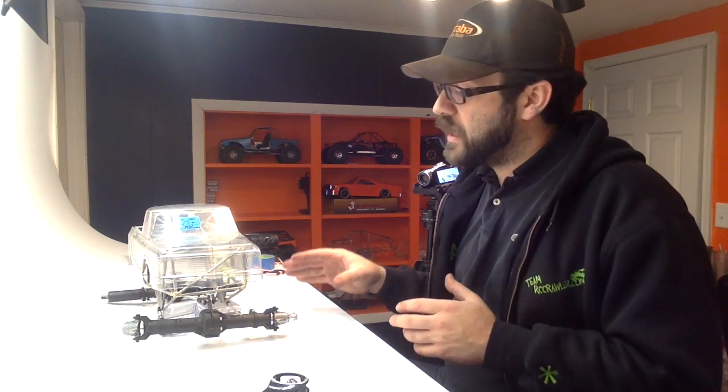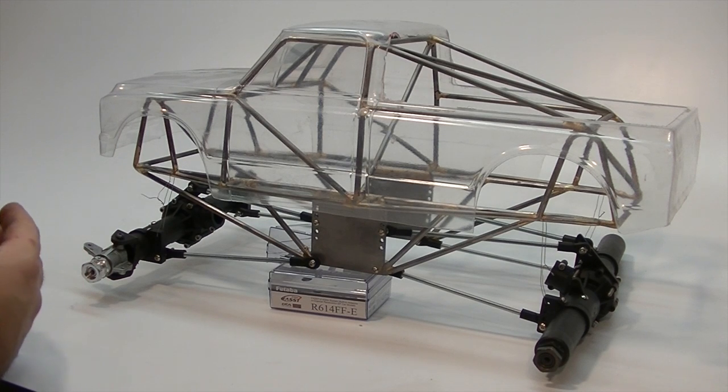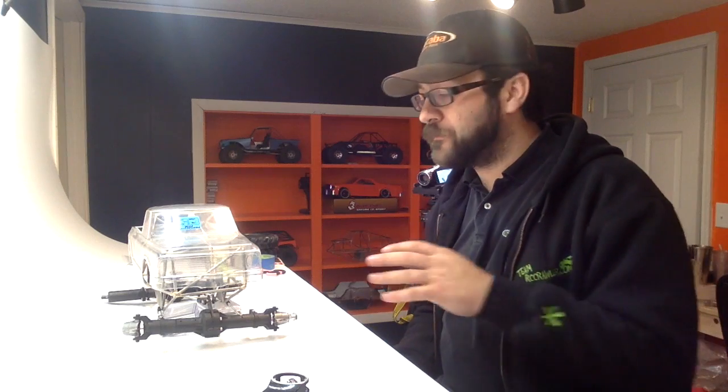Now to get onto shocks — since I finally got the suspension mocked up, I wanted to check the length of the shocks I'd be using. I've got a number of different shocks and sizes around the shop, and what I found is that the original AX10 length shocks seem to be about right. Those are a little longer than your typical 4-inch shock — I think they're somewhere in that 4.5 to 5-inch range. I'm going to look for some options on shocks that will work, something that looks good but has enough dampening power to make this truck controllable. I'll pick something soon so I can get those on the way and finish the chassis by brazing on the final shock mounts.